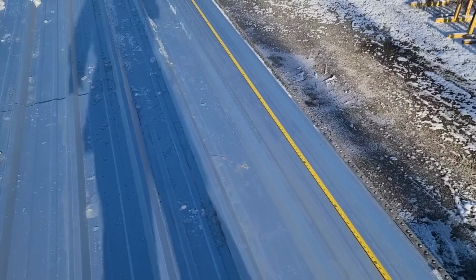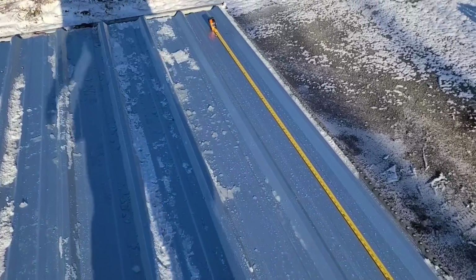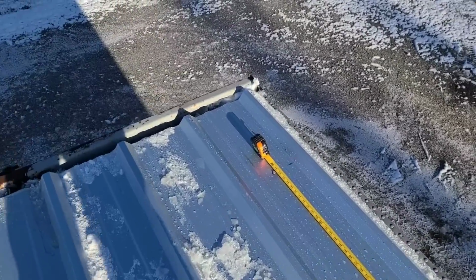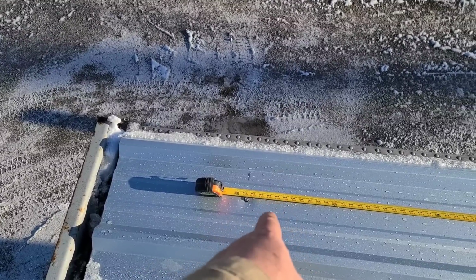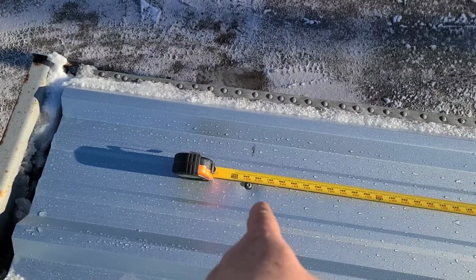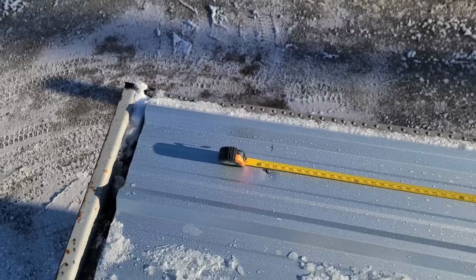So, obviously I wanted to look at how it came out at the end. Now, on the very last one, it's an inch and a quarter off. This comes out to this very last one where I know I've hit and I've got a good screw. That's at 24 foot 10 and 3/4. So we're an inch and a quarter off down here.